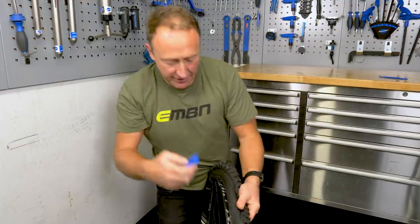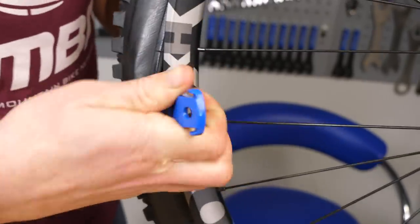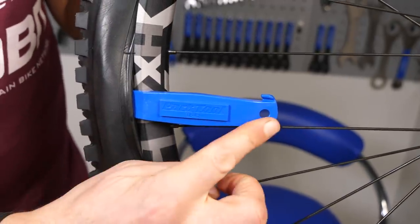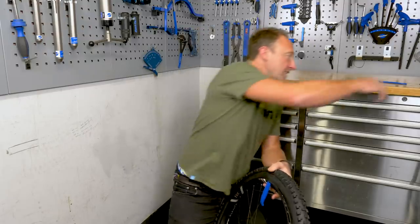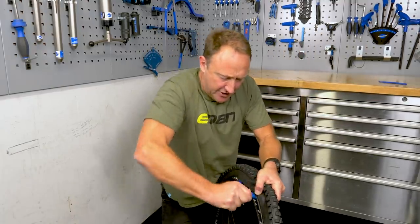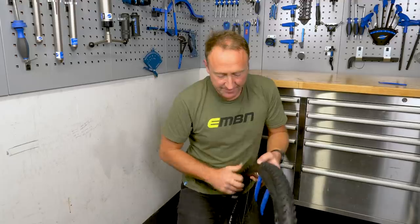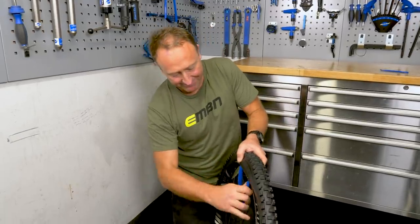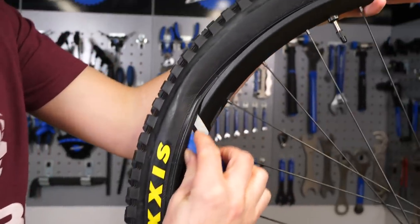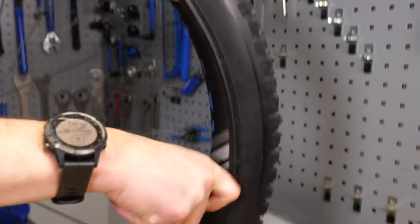I've got my plastic lever — get it in there. That's pretty tough. I've got one over. Many tire levers have a clip part which allows you to fix them to your spoke, so you set the first lever in place. In she goes and over it goes — it really is as easy as that. Once you've done that, a little bit of brute force. Because this plastic won't damage the rim, I insert the lever back in, push it away from you, towards you, and off she comes.